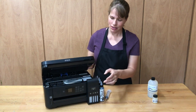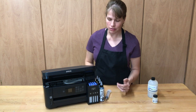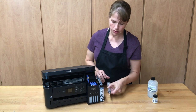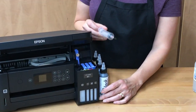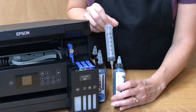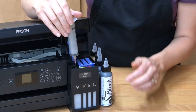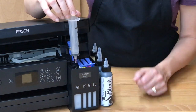Let's look under the hood and see how we fill this thing. This eco tank is a little trickier to fill, so that's why I chose it to demonstrate. Each of these tanks — you can see they're all empty right now — you lift up this tab and that opens a little orifice in the top. We sell our inks with a syringe and a blunt tip needle so you can fill it. Stick the syringe in there, pull the ink out, then stick it right in this tiny orifice. It'll only go down maybe a quarter of an inch, and you just fill it up from there — you'll see the ink fill right up. It's actually pretty easy.